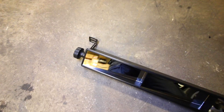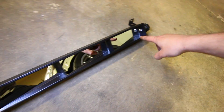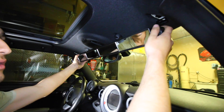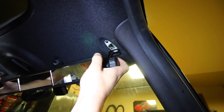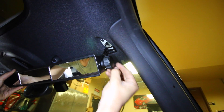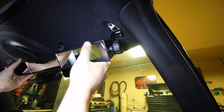So this is what the mirror looks like. We've got an adjuster hinge right here, we have our bracket that's going to mount up to the car, we have the Wink mirror itself, and we have the exact same thing on this side. Whenever you're ready, basically just align this however you want. I took out one of the Phillips screws that was in place right there and that's where I'm going to be mounting up this little L bracket so the Wink mirror will be mounted in place. Just align it as to however you want it, grab that little Phillips screw that we took out before, and if you just put it in hand tight this side is going to be in.